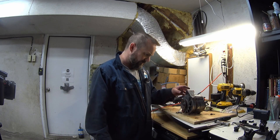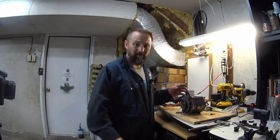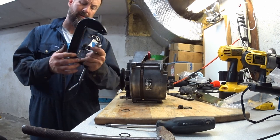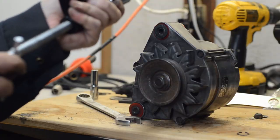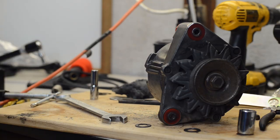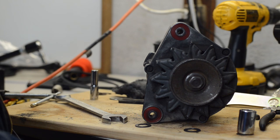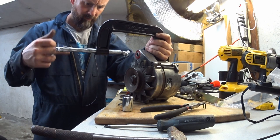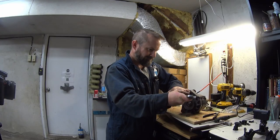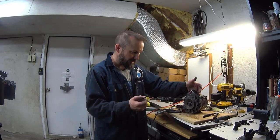These urethane ones are really having trouble squeezing to get the c-clip on. I might have to take this to a press because I don't have enough force in my arms to get it to close. This is one of those jobs that should be super simple and I don't know what's going on. Even if I had a press, I don't know how I'd get enough force to get the snap ring in. I've got like a whole millimeter to go before I can even think about getting that snap ring in place.